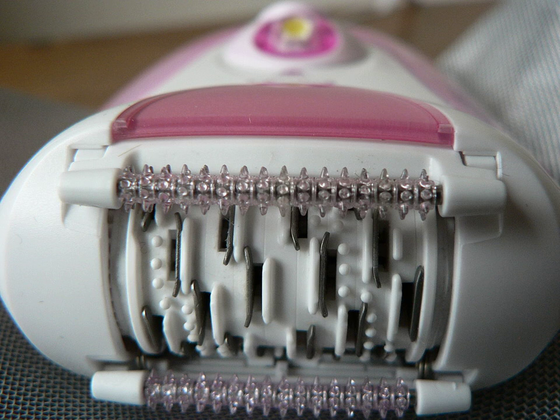The rotating disc design has been refined such that in modern designs the plates are no longer complete discs. The head of a modern epilator incorporates a series of metal plates mounted in a plastic housing, with the ends of the plates exposed at one or both sides. As the head rotates, the tips of the plates move together and apart once per revolution, creating a tweezing effect where hair is gripped, pulled, extracted, and discarded. Depending on the strength and brittleness of the hair, some may snap off just above the skin surface, resembling stubble.